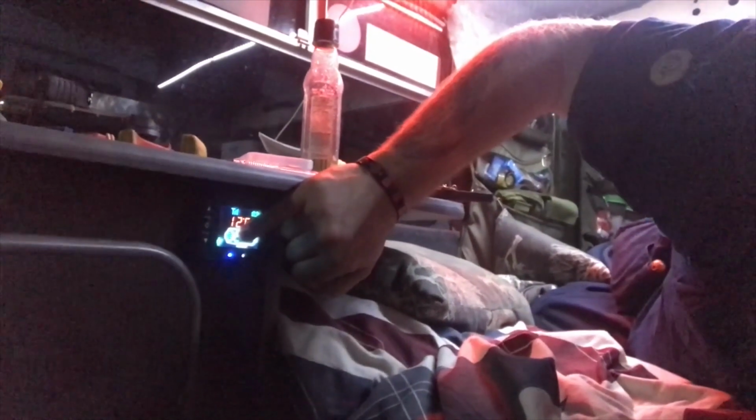So as you can see now, the fan's speeding up slightly. You've got the fuel pump symbol on here, which means it's pumping the fuel in, and it's going. I don't know if you can hear it, it's not that loud at all. I'd definitely say for your average size Land Rover or small van around this size, this would have benefited from a 2K one, but I got the 5 because I wanted this display. If you can find a 2K one with a digital display, that's probably going to be a bit better for you, to be honest. Use a bit less power, a bit less fuel, but happy days, this is a good one. For the 120, 125 quid that they cost, I really can't knock it, because it's cheaper than the nearly £200 that I should have paid to have mine fixed.